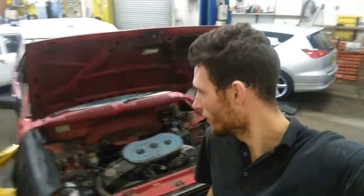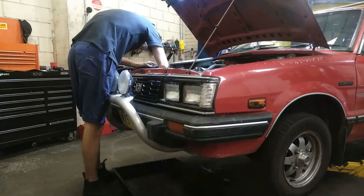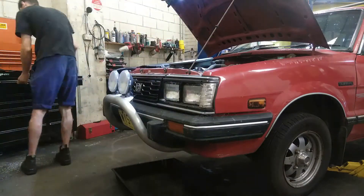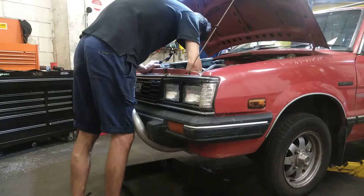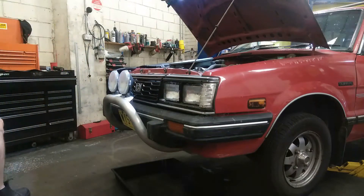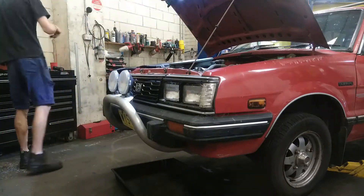Back working at the front — this is the last time the engine's going to be in there and operating, so I'll get a crack at it. I've taken a lot of Subaru engines out before at work, so we'll see what this one's like. I'm hoping to give a bit of a time lapse so you can see what it's like. When removing the engine, I have to make sure I leave things to the side that I may need later — electrical things, hoses, or vacuum lines that might be used elsewhere in the conversion.